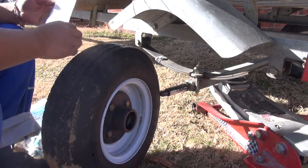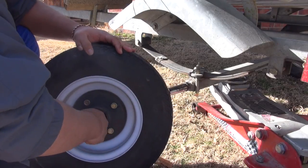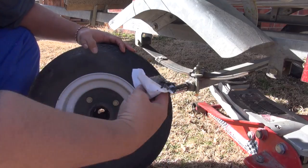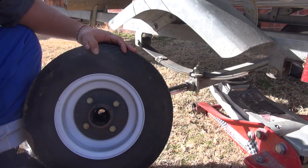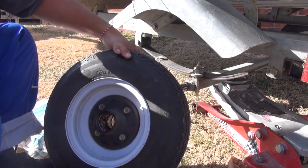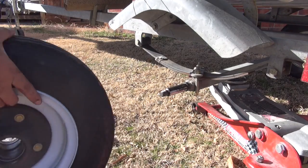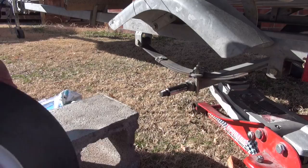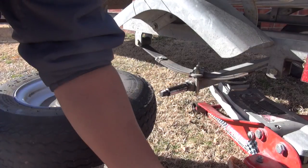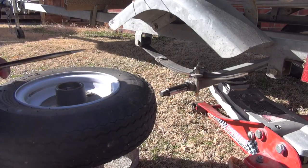For the cleaning process I usually use just tissue paper to clean it out. You'll be removing a lot of grease — the grease used to be red but now it's black. Once you get it cleaned to that point, it's time to knock out the sleeves. For that we're going to need a cinder block. Kind of do this — locate where the sleeves are and pop them out once again with a big screwdriver.